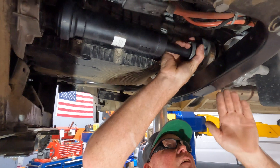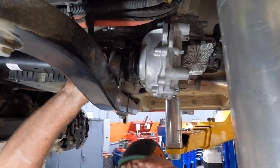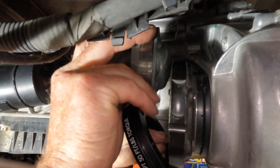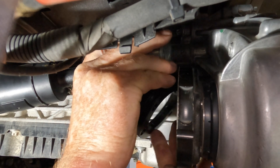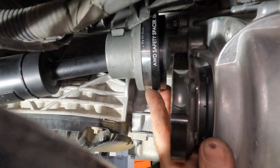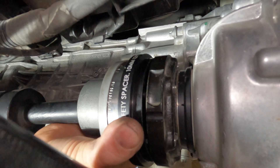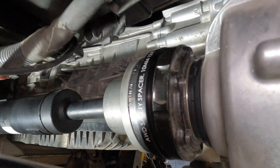In order to put this spacer in — you can see there's not much plunge in the whole assembly, so it's a little tight. What we're going to do is put this over the driveshaft first, then lift the driveshaft up and it'll register over the CV. Then you'll be able to slip it down and slip on the billet spacer. We're going to slide this down and register it in the transfer case flange. Now it's just a matter of lining up all the holes and reassembling it with the new hardware.